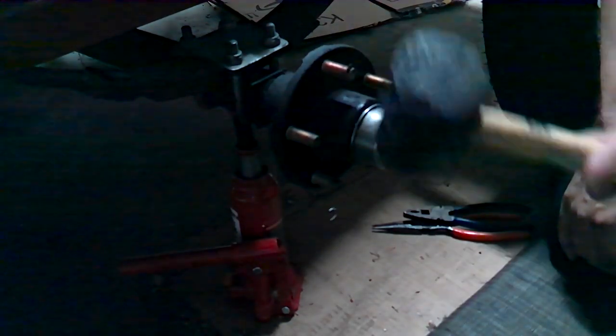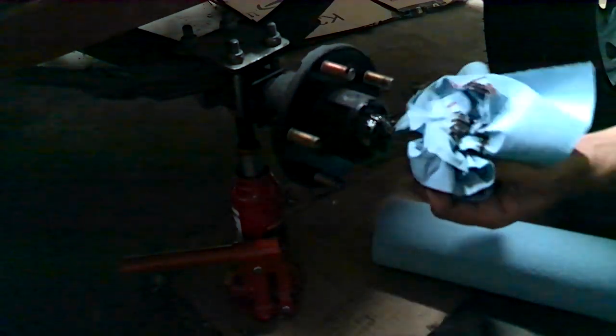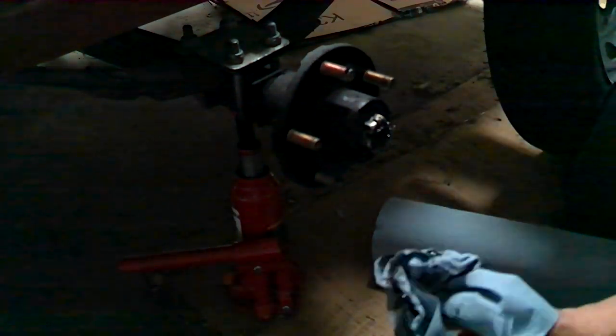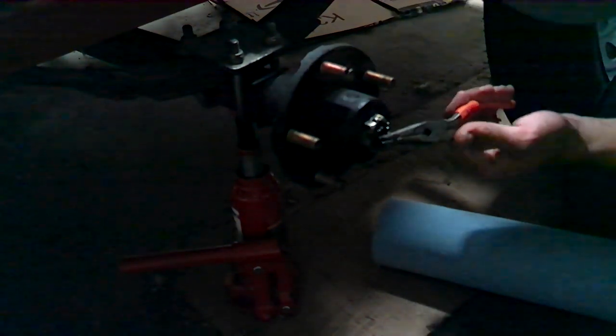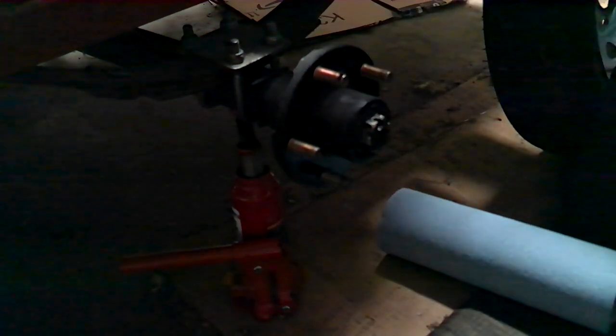Here's the wheel hub. A couple days ago I was having issues with it — I went and re-greased it and tightened down the castle nut. That's why everything is really well greased, with some red grease in there too. It was well greased when I fixed the castle nut. I always make sure to grease these bearings very, very well — that's how they've lasted four years.